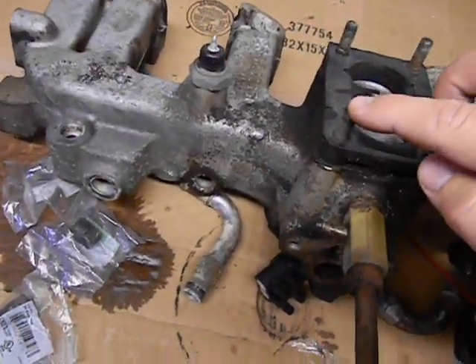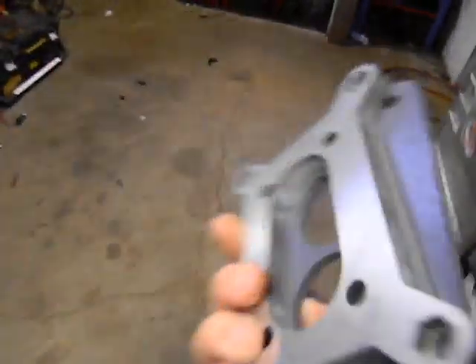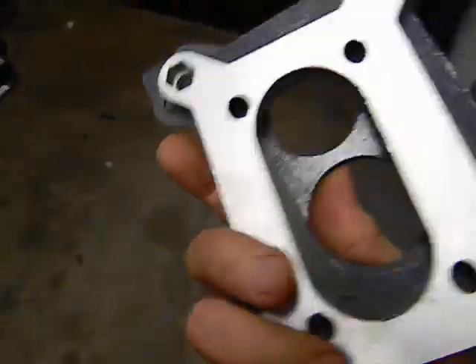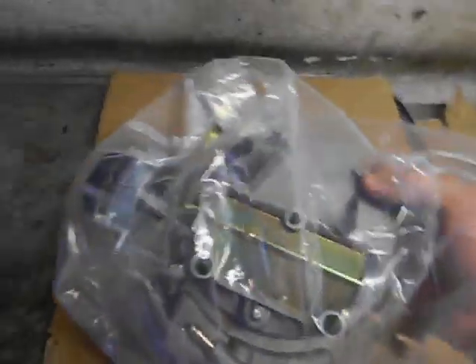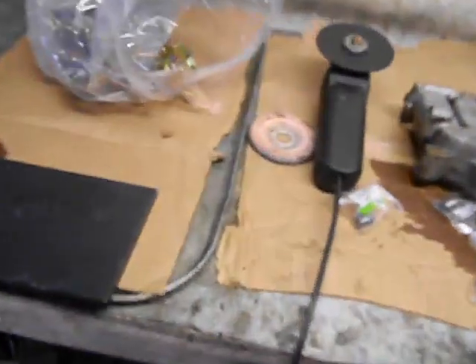So this is the first video on the actual assembly. We're going to pull these studs off the intake, and I've got this adapter kit - it's the small two-barrel to big two-barrel carb adapter they sell on eBay for about $18, comes with gaskets. I also got this 2150 carb. I would not use a Weber on this setup - the 2150 is a much better carb, pretty simple, they made a ton of them. The HEI distributor goes on the other side, so this will be a very basic and reliable design.